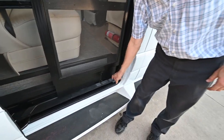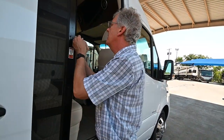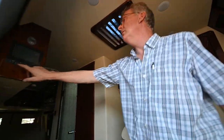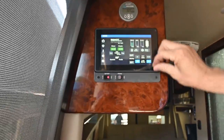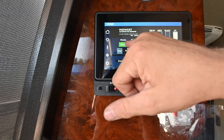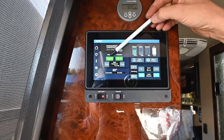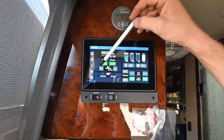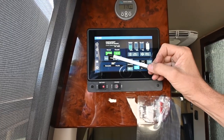It's nice to have the screen door to keep out all the bugs and critters. Now let's take a look inside. I've got the main control panel up here. You've got a battery switch — you turn that on, you get power on the display. I want to look at the house power and the chassis power. The house is at 14.4 volts — I'm plugged into shore power now, so it's powering up well and charging the house battery. The chassis battery is also at 13.5 volts, and that's the battery that starts the engine.